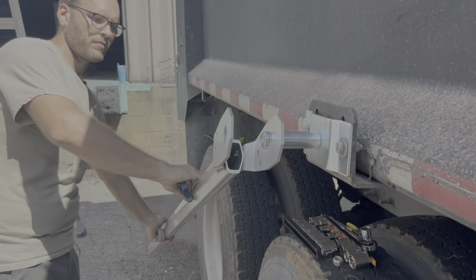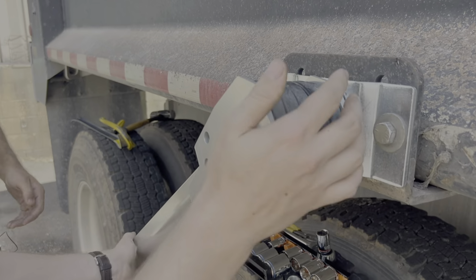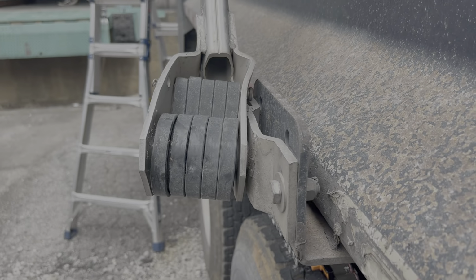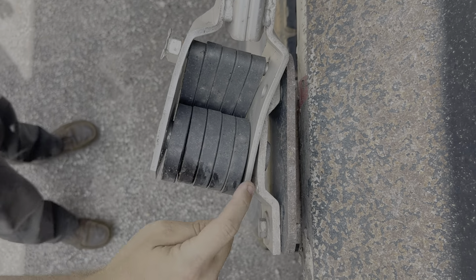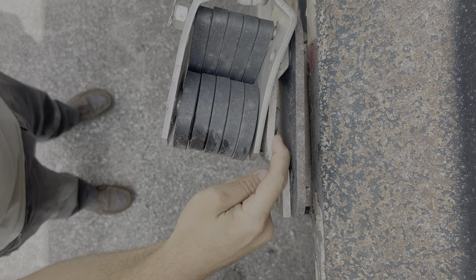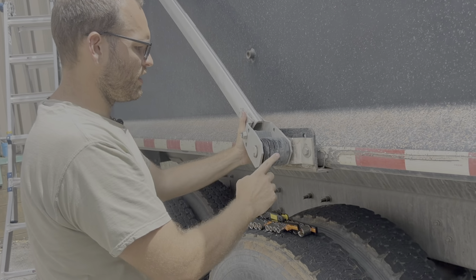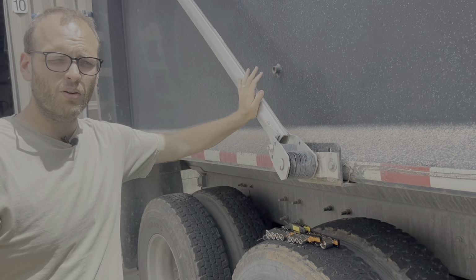Today, we are replacing a 5-spring lower arm on a front to back tarp system. Someone bumped into this without paying attention. If you look down this on the top, you can see how the pivot pin is crooked now. And if you can see down in there, the weld is breaking. The top is fine, and this bracket is fine. So today we're just replacing the pivot pin and the lower arm itself.